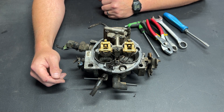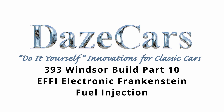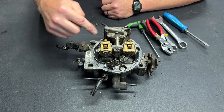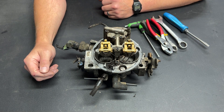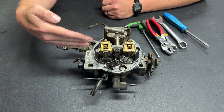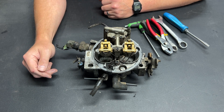Let's talk about EFI, or in my case, Electronic Frankenstein Injection. Greetings fellow DIYer and welcome to my video. If you saw my last video on my 393 Windsor build, I hatched a plan where I'm going to take two Chevy throttle bodies, remove all the injector components, and basically connect them together and use them in tandem as throttle bodies to provide the airflow to my motor. I can put them in line, cut the throttle linkage section off, and still maintain the throttle position sensor.